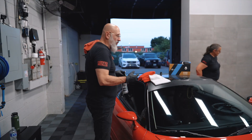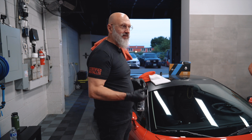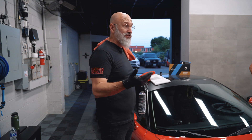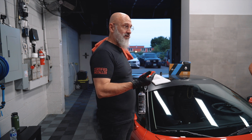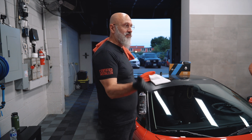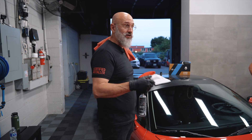This is more for the person that doesn't know how to use a ceramic coating on the windshield — meaning they're still going to throw the wipers on when it starts raining and leave them on until after it stops. When someone has a ceramic coating, you give them the instruction that as soon as it starts raining, put your windshield washers on to wash the traffic film off the windshield. Now your coating is what the water is hitting and it's going to perform. But if you don't use the windshield washer fluid and just let the wipers go over that oily surface, you're never going to get the durability and performance of the coating that you're expecting.